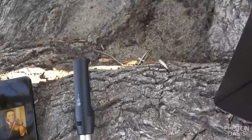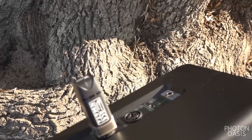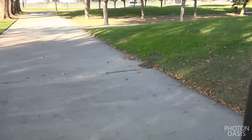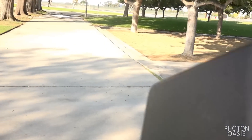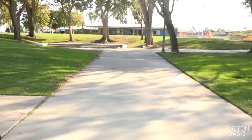To stress test the range, I had the transmitter plugged in right next to my phone, which was acting as a Wi-Fi emitter, and then I took the U3 for a short walk. I got about 92 feet before distortion, which matches the specs pretty well.